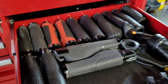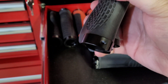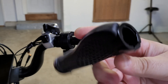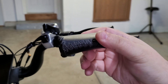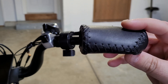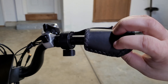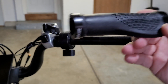Let's see which grips I want to use — I'm going to go with these right here. These have clamps on each end so they will stay put on the bars. The reason I prefer clamps is because the stock grips they give you, while they feel really good — they're the standard stitched leather style on most e-bikes — they tend to turn or twist on the handlebars over time. You put your weight on the palm rest and it tends to tilt downward. To prevent that twisting, I go with grips that have clamps on both ends.